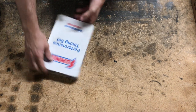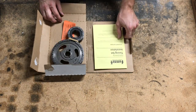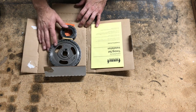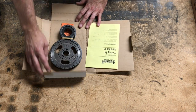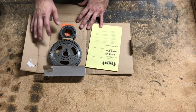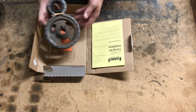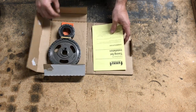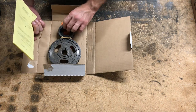Next up we've got a Summit Racing performance timing set — the timing chain. I picked this up a long time ago to build this engine, several years back, but I didn't end up assembling it as I was moving around — moved to Texas, moved back to California. While in Texas I had a bit of a storage fire and lost all of the rings, bearings, gaskets, everything to build this engine. Luckily the block, crank, and other major parts were in another storage unit and survived. We've got a little bit of surface rust here, but that won't be any problem. The chain still looks really good. It's got settings for straight up, advance, and retard, and I'll be installing it straight up, dot to dot.